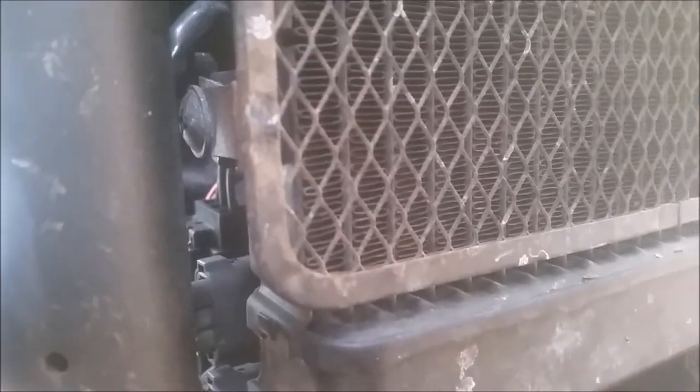I think I found the easier way. Down here there's a 10 millimeter bolt that goes right in that hole, and then this bolt and that bolt over there is 14 millimeter. You take this bracket off and then you can pull it down, because that's what the radiator sits on. You should then be able to move the radiator out just slightly — just enough to get that screw right there and the one on the other side off. Then get the top two off and you can put the grill on. You've got to remove the top mount bolt up there and then remove these two bolts down here — that bolt there and the one back there that holds the bracket on.